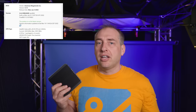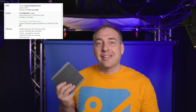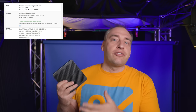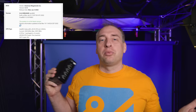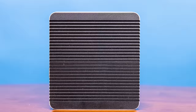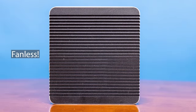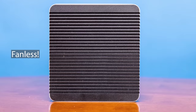You don't get features like 10 gig ethernet or Quick Assist Technology, so there are definitely things you don't get in this. But for a pretty low cost box in the range of maybe $250 to $350 to set up, it's not really that bad that you don't get all those extra features. You can't see the processor because it's affixed to this side of the chassis to allow good thermal transfer and thermal interface between the processor and the top of the unit.